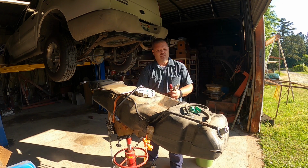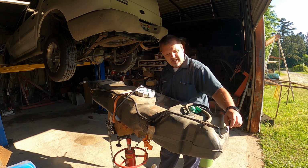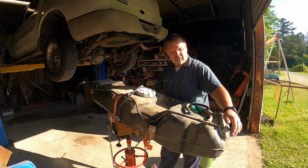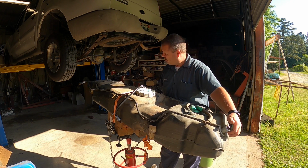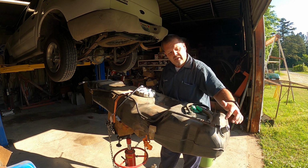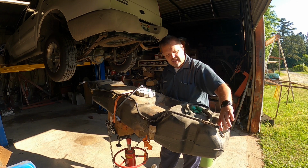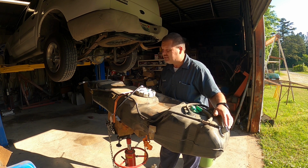All right, the fuel filler neck. It's a big old lip on it, right? And it's straight, so it holds that hose. You almost don't need a clamp. When it's new, you do, but once you get a few years old, you don't need a clamp really. So this thing is about 18 years old. You got to make sure you can pull this off before. I tried, and I finally had to slit it and get it off. So I got to cut that filler hose off a little short, but it's still plenty of slack.